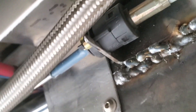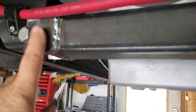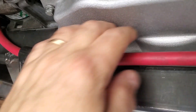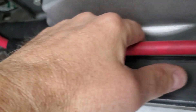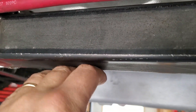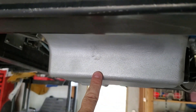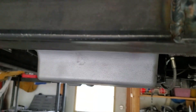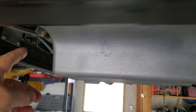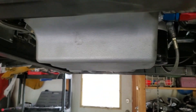The other thing I did was I put this new cross member in here. Instead of putting it flush with this piece here, I moved it down a little bit because I wanted to have a little more clearance between the oil pan and this cross member. Having it down a little bit will also allow a nice skid plate to protect the oil pan. I'll probably use some 3/16 steel and support it on the sides so that it's nice and strong, so basically the car just kind of slides over whatever it hits.